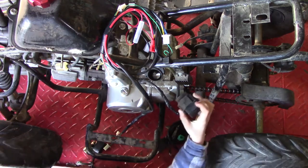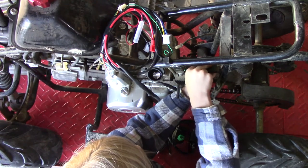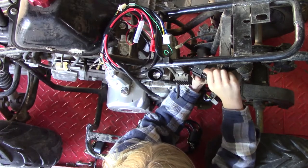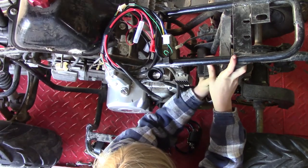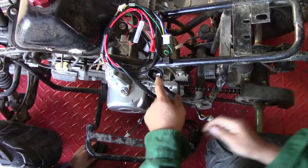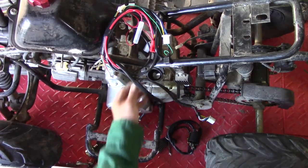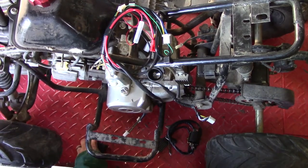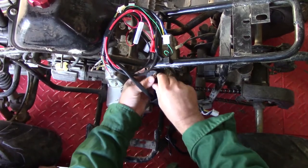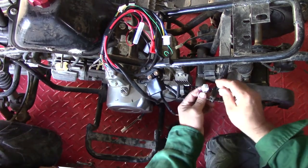Since this boot is too small, we're going to hook it under this little rubber band. The other one had it zip-tied on. That's the new boot — it's hard to get on. It's got to stretch over these little tabs. And that holds this starter solenoid, which we will have to hook wires to. We can plug this in because this just goes right to the CDI box.